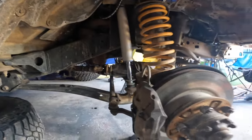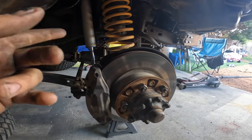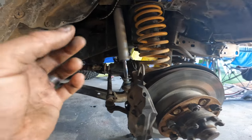We've got the wheel off here, wheel off there. We're going to go take the hub bolts off, take the caliper off, pull the rotor off, then hopefully we can just sleeve out the CV. Then we've got to disconnect the front tail shaft, take the center out, and put our new locking center in. Hopefully the second one should be a bit quicker because I've learned what I need to do from the back one — it's going to be pretty much the same.